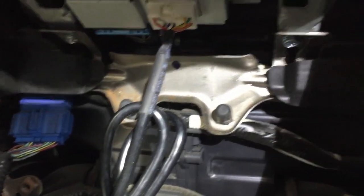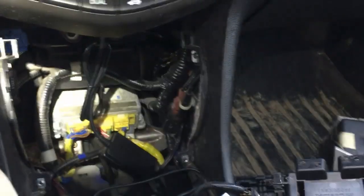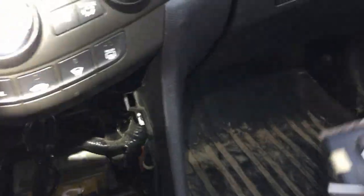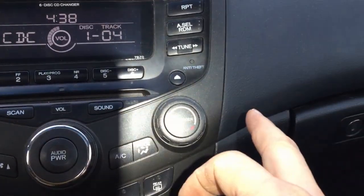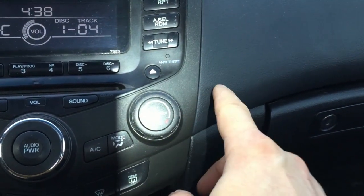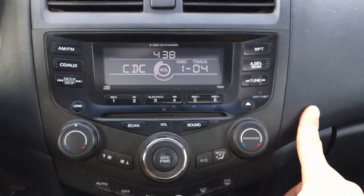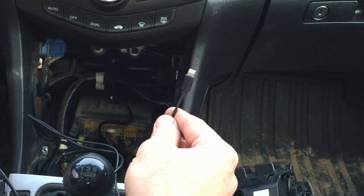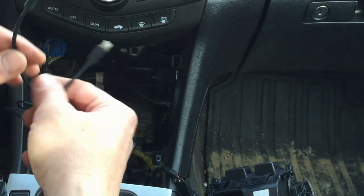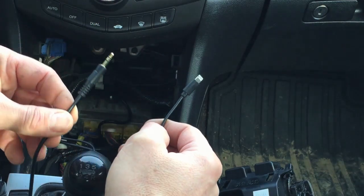On your installation, you might hide this 3.5mm jack somewhere in a hidden area. Let's say here, drilling a little hole on the back, or you can use another accessory for these AUX systems, which comes with a 3.5 female connector or 3.5 female plus USB. It might end up somewhere on your dash, depends what you like. From this point on, you can actually close everything back together and use just the 3.5mm audio jack to play your music. And you cannot receive phone calls.